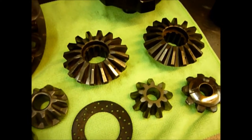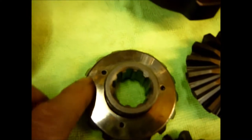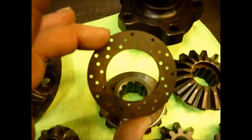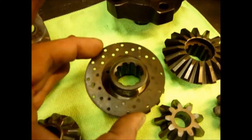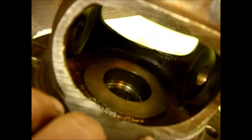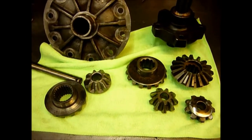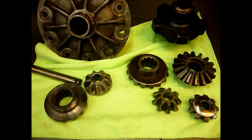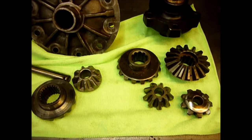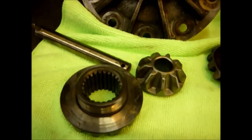However, better than that — on the back of these drive gears, the three holes are here. So the oil can be pushed through by the gears meshing, and as the oil pushes through, it goes onto this thrust pad which has numerous holes on it. And what that does is it rotates, and as it rotates, it washes the back face in there with oil. You have to take your hats off to these people, because they knew what they were doing when they built this. This is brilliant engineering, and sadly, for the sake of a few quid, they don't cross-drill the gears. They don't put oil rotator thrusts on there. They just put cheap gears and some thrust pads on there.